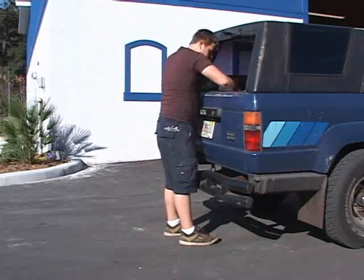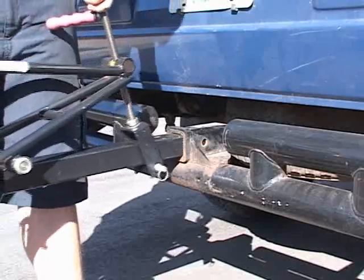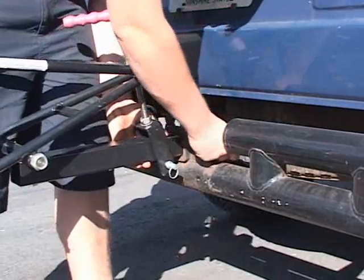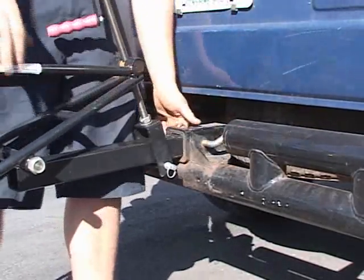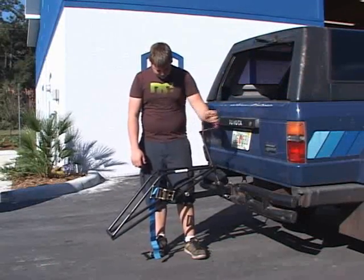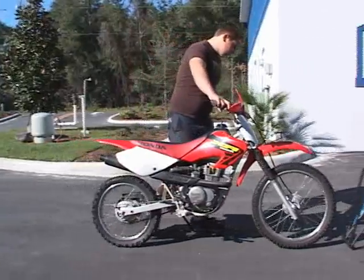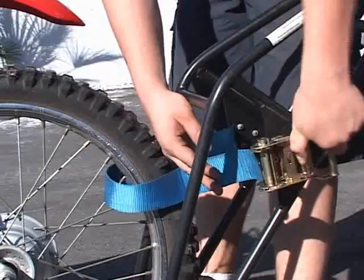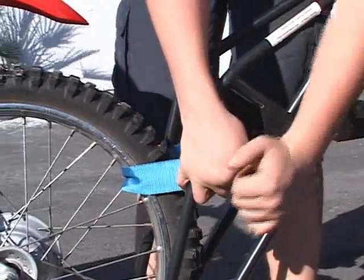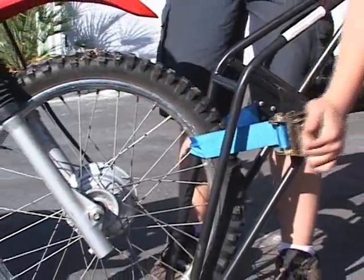The Undertaker is compact for easy storage. It fits into a standard 2-inch hitch receiver — secure it with the hitch pin. Then crank the cradle down to the ground surface. Advance your motorcycle into the cradle, leaving the kickstand down. Route the ratchet strap through the spokes and around the rim in a manner not to bend any spokes, and tighten with the ratchet to draw the wheel snugly into the cradle.